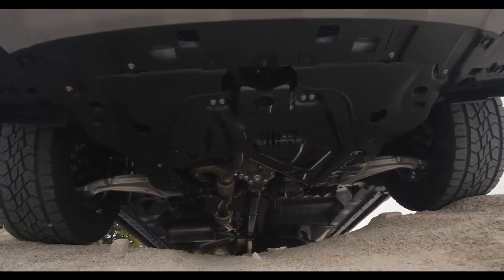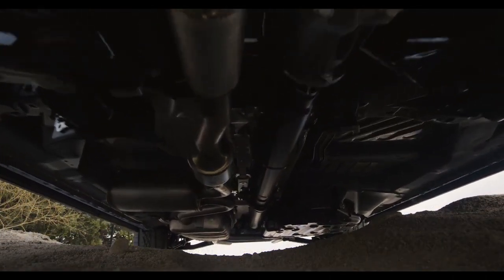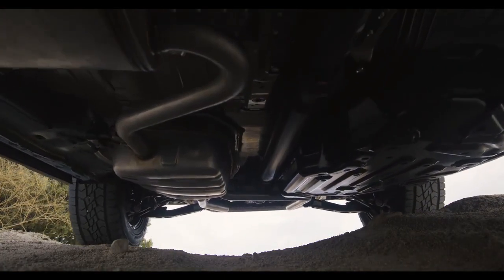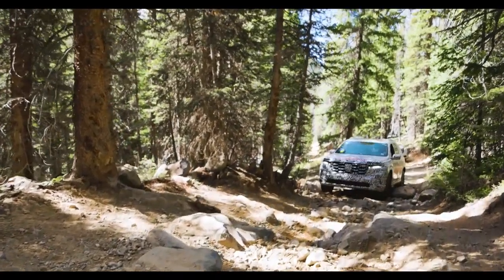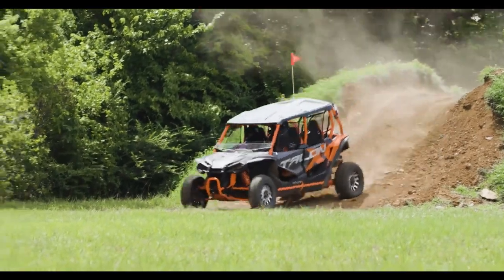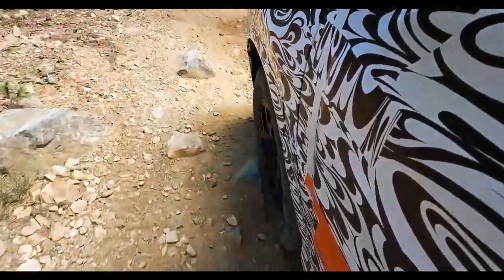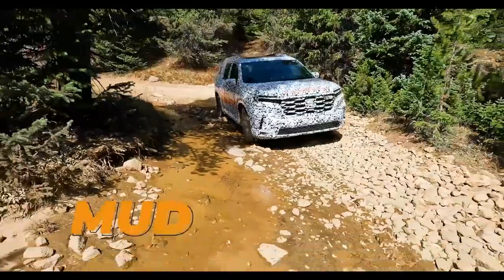To address all those factors, we made sure the material and bolt sizes we picked do not impact crash worthiness. We added air vents onto the skid plates to ensure they don't impact heat resistance or aerodynamics. The durability team incorporated requirements from Power Sports and adjusted them for automotive, to ensure no damage would occur from debris such as gravel, sand, tall grass, and mud.